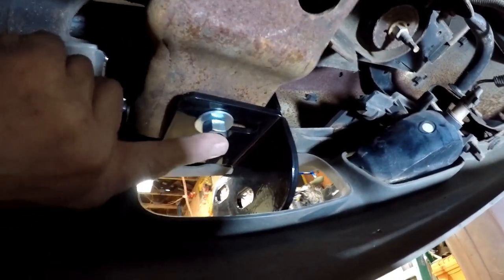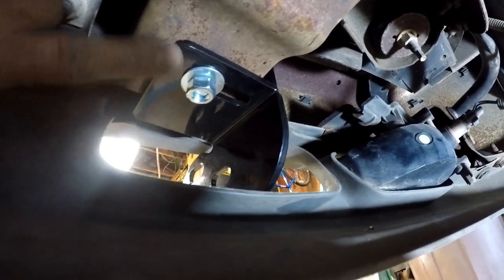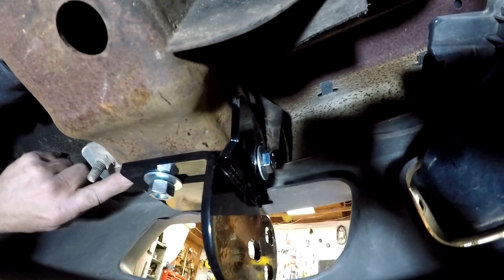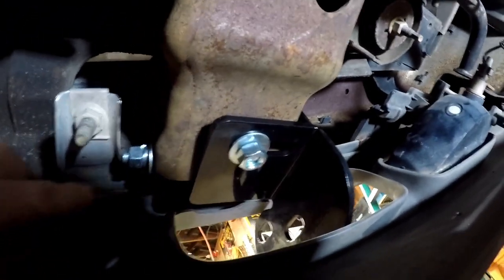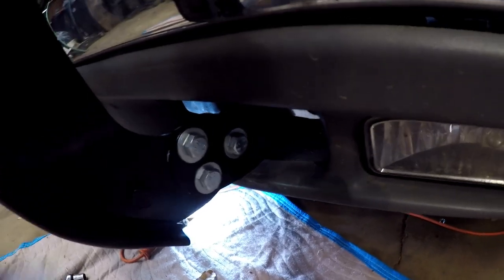After installing both mounting brackets, some things to note: I'm going to leave the lock washer off this bolt which I put in first and hand tightened. Once I get everything tight I'll go back and put the lock washer on — it just didn't give me enough thread to get it started. The long bolt threads in pretty easily from that side. Everything will tighten up and I'm going to go outside and get the brush guard on.